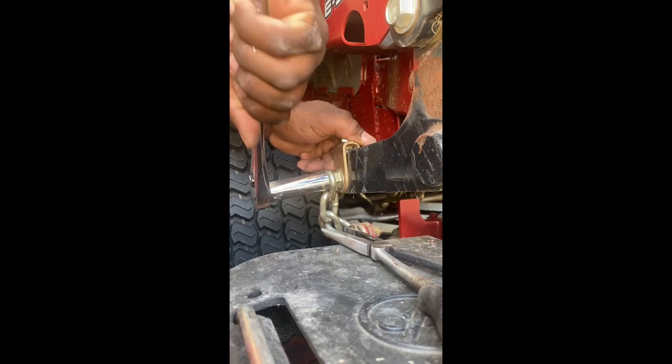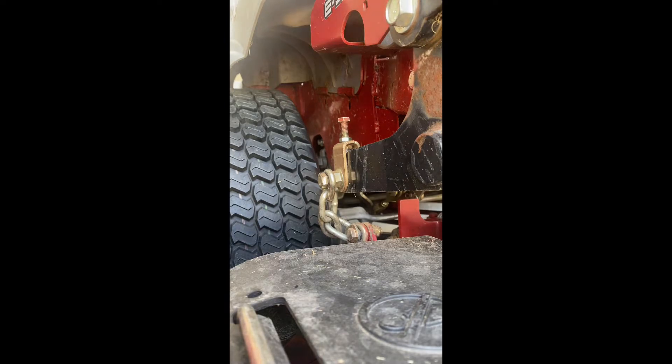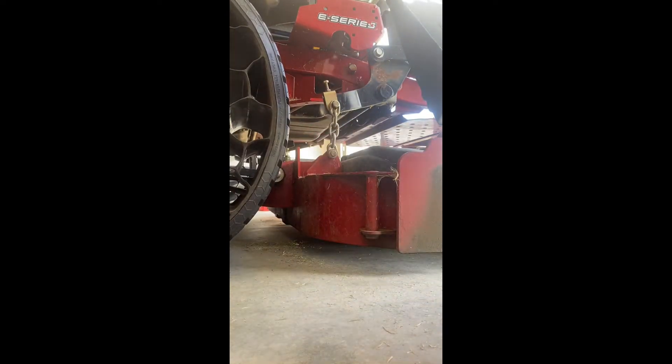This is a 5.8 that I'm using here. I'm gonna measure underneath here and make sure — actually, you don't want it super level. You don't want the exact level. You want the back actually a quarter of an inch higher than the front of the blade. I'm gonna get a measuring gauge and just see.